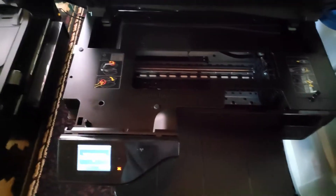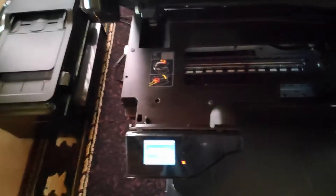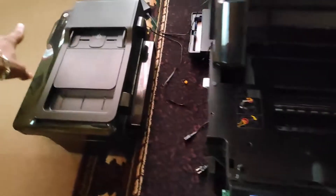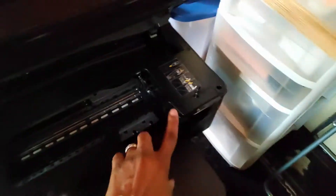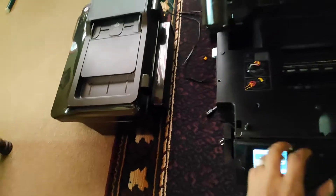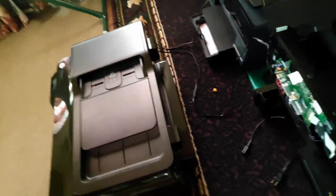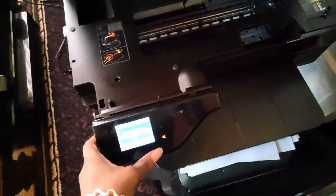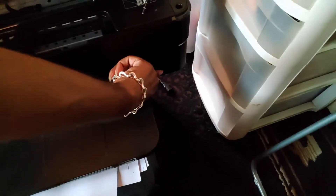Those are the two problems. In the next video I'll swap the boards — you'll see this one might still be locked in the corner but you'll start getting a carriage jam error, and the print head in this one will not be moving at all. It's as if the board itself is telling the printer: 'I know your carriage tray cannot move and it's not supposed to be moving,' so it just assumes it's not moving.